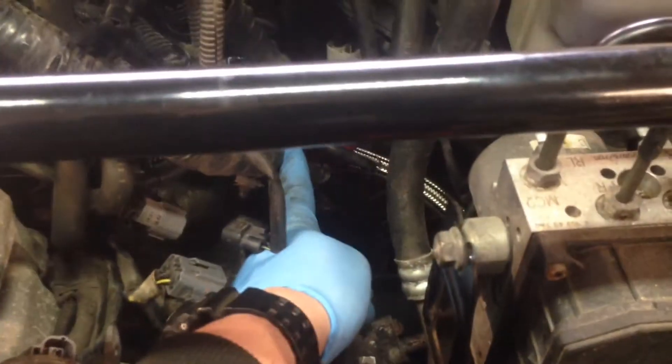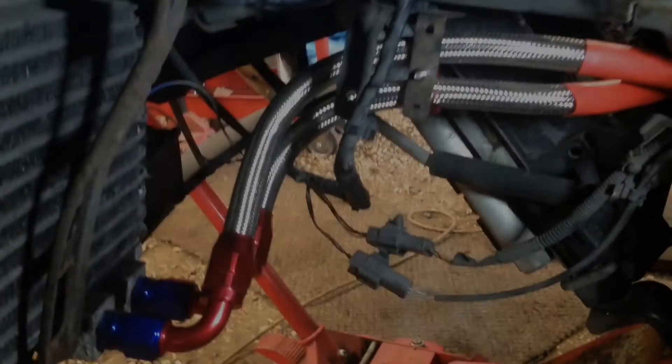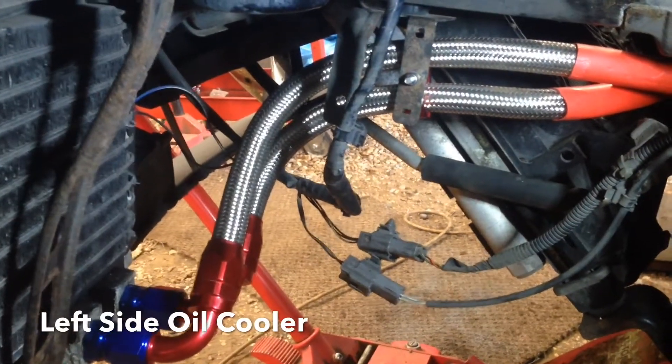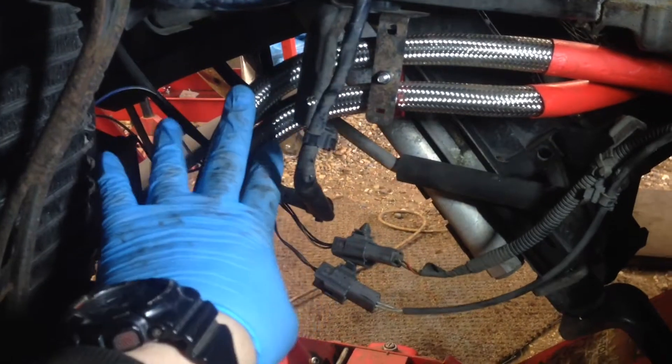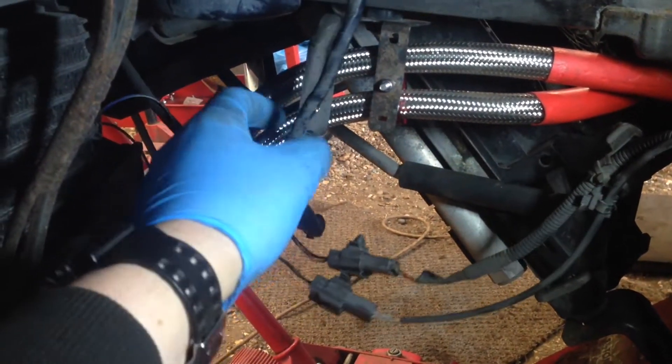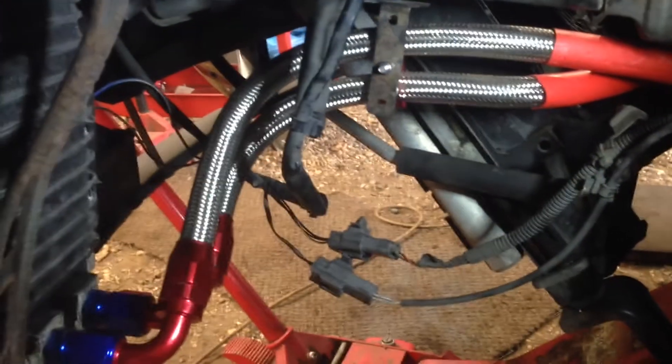On the left hand side of the car, the first thing to note is that the routing of this cable goes over the oil cooler hoses. Some people get it mixed up and end up getting it stuck behind, which once it's hooked up is not fun to fix.